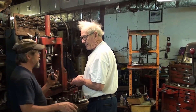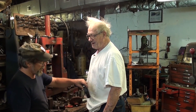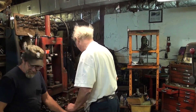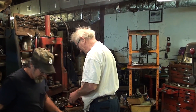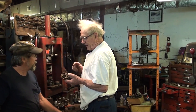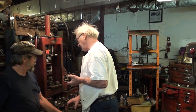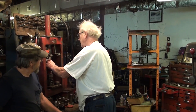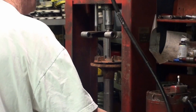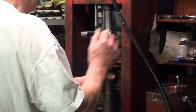Let's step up in our technology. Audio will be greatly improved from this point forward. We broke loose the impeller because now we have to push the bearing through the housing, and this is not the strongest impeller so we don't want to break it. If we break it, we're in deep doo-doo — except for this other pump that showed up on his boot tip; we don't know where it came from. Bingo! We didn't break it.